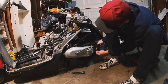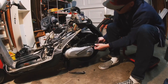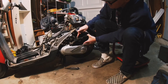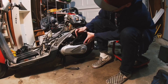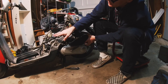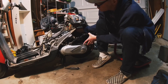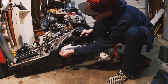This hose has got a little clamp to hold it over there. A few hoses on here — just for reference later in case I want to put this back together. This hose right here at about the 10 to 11 o'clock position goes to the top of the valve cover. This hose at the noon position goes to the top of the carb for reference.